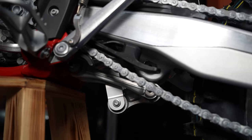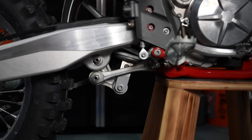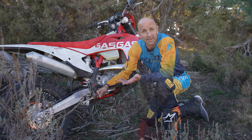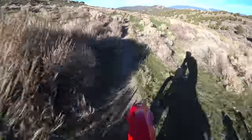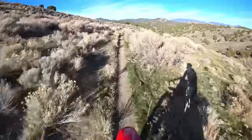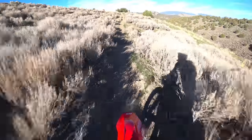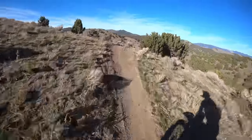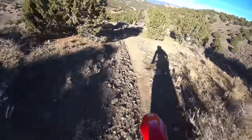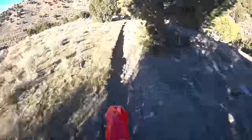You've got linkage on this bike. A lot of people will say PDS versus linkage — maybe if you're riding a motocross track it matters. I'm the type of guy that sets my sag the same on most of these bikes, anywhere from 105 to 108 millimeters. This one I put to 106 and it worked beautifully. We've definitely got the wide ratio gearing on here, same as what you've got on a KTM XCW or the Husqvarna TE. That front wheel is just glued to the ground — it's so good.